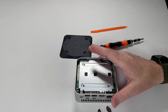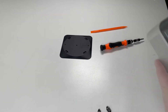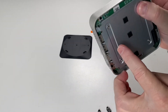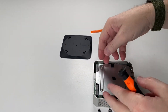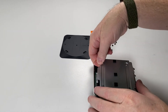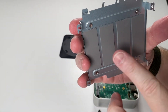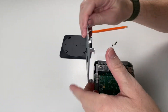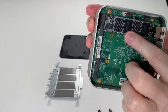With it open, there's another plate to remove to get to where the SSDs go. The screws are recessed in a crack around the perimeter - a couple at the bottom and a couple at the top. You need a really small screwdriver since the screws are very tiny. Once the plate lifts off, you can see there's heat sink material on the plate that makes contact with the SSDs.